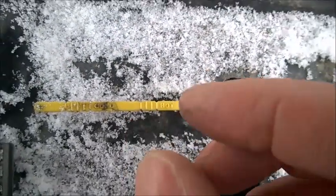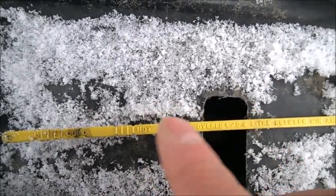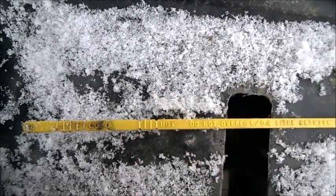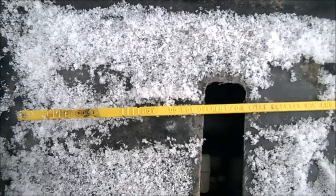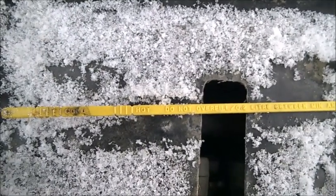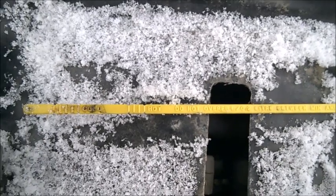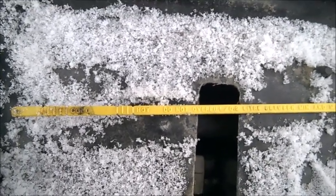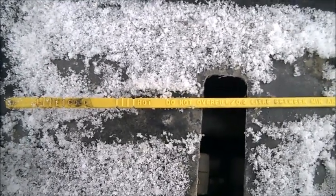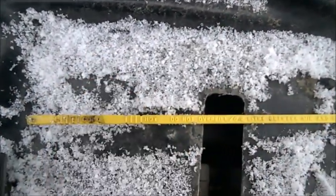You have to have the fluid at the hot mark. When you pull the dipstick it may have smear all over the place, so look for the thicker area with fluid - it should be right there on top. Use 3309 fluid, either Mobil 3309 - careful, it's not the same as Mobil ATF regular - Toyota Type 4 from your Toyota dealer, or Manol in Europe which also has 3309. I did not have a good experience with Valvoline MaxLife, which is also 3309 - it was expanding too much in summer and shrinking too much in winter.